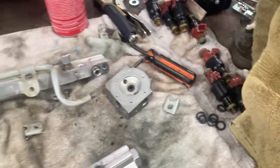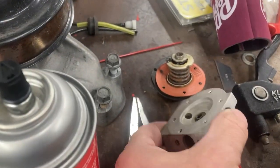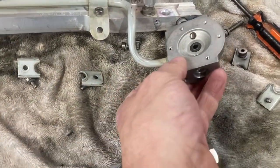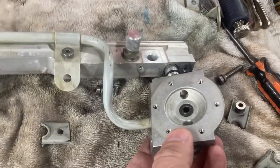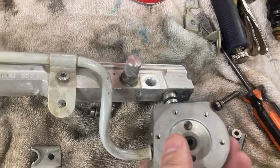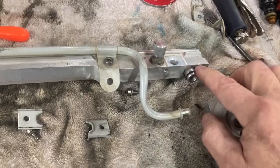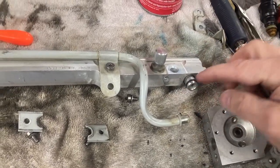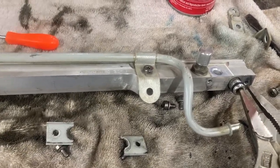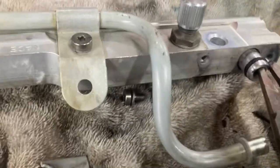Here's the tricky one — it's kind of hard to take the fuel pressure regulator off. The fuel pressure regulator is sitting right there; I took it off but that's an adjustable one. It has to go on like that, and then the other one has to be pushed on at the same time — so it goes on as a series. There's an o-ring here you replace, but this tube that you think is part of the fuel rail is not — it's force-fitted in there with another o-ring. I'll show you — see that moving? It has another o-ring in there that you have to pull out.